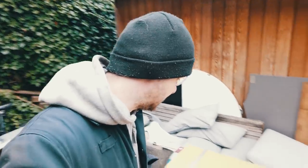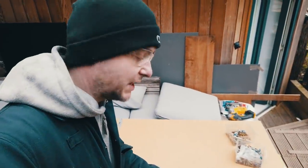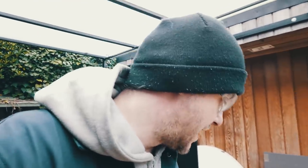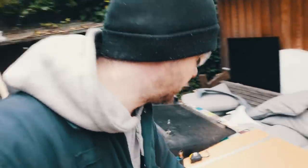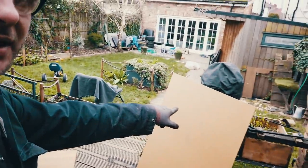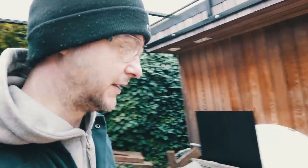The way I'm doing it is basically I need to make three internal ribs on which this will be sitting. Because it's going to be radiused ever so slightly, I need them to be exact. So we basically cut three pieces of plywood. They are 22 by 88 centimeters. Now we're gonna screw them together so they don't move. And we're gonna create a profile. Then we're gonna cut it, sand it, and we're gonna glue it to this board in the center. And that's where this piece of MDF is gonna sit and create this profile.